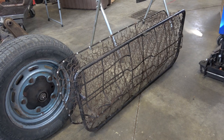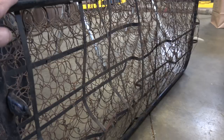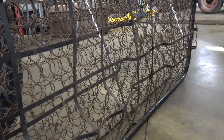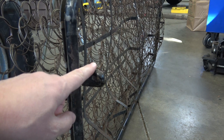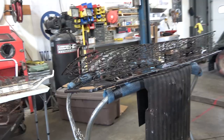The problem is if you have the correct '55 and earlier seat frames — and I think these only work correctly if you go with a later seat frame — it's not going to fit right for the rear bottom backrest. Look at this '55 frame: look at all the spring here, and you have the cutout here so it doesn't touch the battery — it's depressed right here. There's a square recessed section so the seat springs do not hit the top of the battery. Springs all throughout the center. In these years there's no divider bar that the seat frames rest on — that goes straight across. Later bugs have that bar; these early years don't.